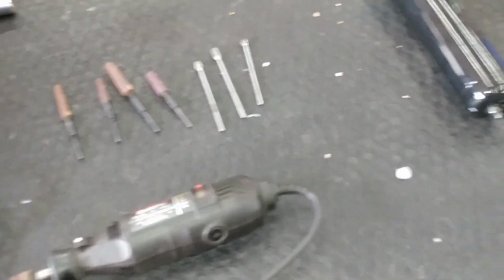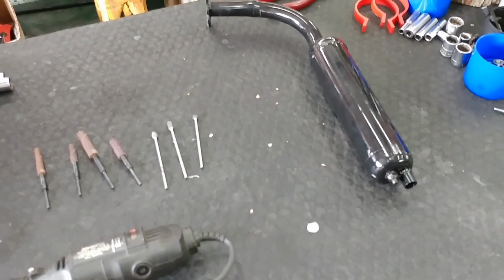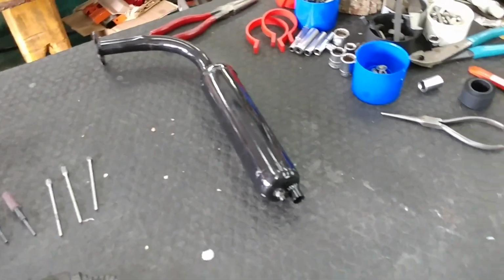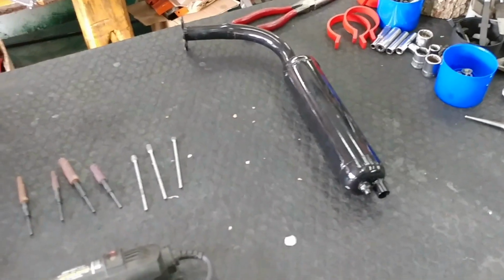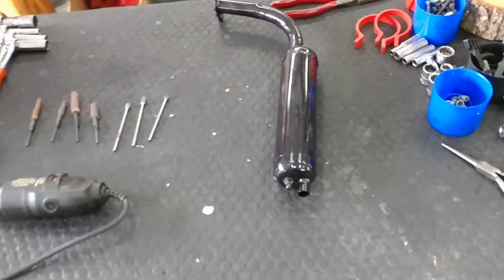I just widened the exhaust port, made it oval, polished it. I widened the intake port a little bit. I raised the transfers and the exhaust a little. I had to because I lowered the cylinder down. I raised the compression just a hair, and it runs excellent. It goes through the grass like nothing. On light trails, it's got some pretty decent power.